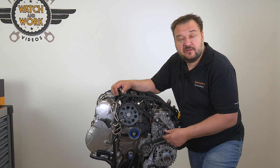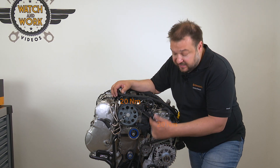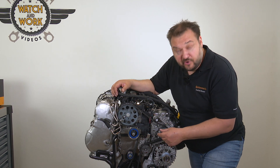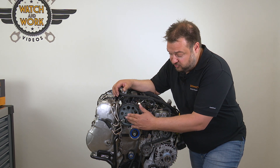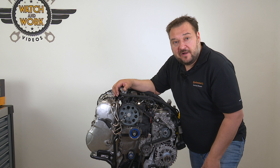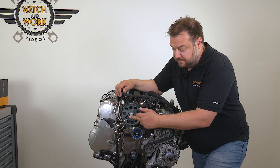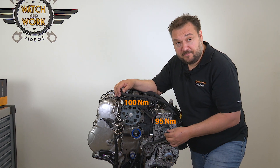You then remove the locking tools and tighten both the bolt and nut to 20 Nm using the counter hold, before turning the engine over for two full revolutions and checking the timing again. You may find that the locking pin for the high pressure fuel pump no longer fits properly — that's okay. What's important is that the camshaft at the top and the crankshaft still align. Once that has been done, you have to repeat the whole process again by turning the engine over twice and checking everything. If it's all fine, tighten the bolt to its final torque of 100 Nm with the help of the counter hold and finish tightening the high pressure fuel pump's nut to a torque of 95 Nm.